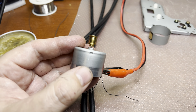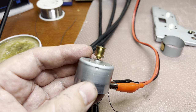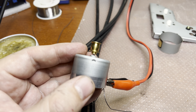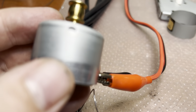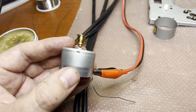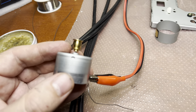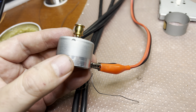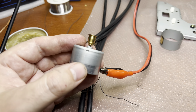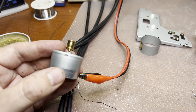Now I'm running the performance test and the motor works about ten times quieter. I almost can't hear the noise — it was quite noisy before, I could hear it from outside the deck. I cleaned up the contacts and oiled the bearings to make sure they work smoothly. Now I'm happy and ready to reassemble. Let's see what flutter result we'll get this time.